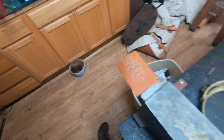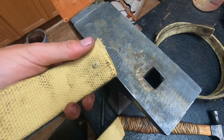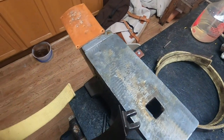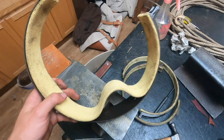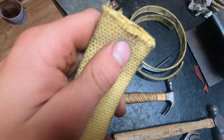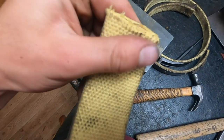So I'll split it over there, bring it here, put it back on the anvil, and then just do a couple more taps with the ball peen on it to drive it further into the band material and give it a good dip, so that the tines of the rivets are set in pretty deeply. So there are the two top rivets. I was sure to peen these pretty hard with the ball peen hammer so that there's a noticeable indent right there,